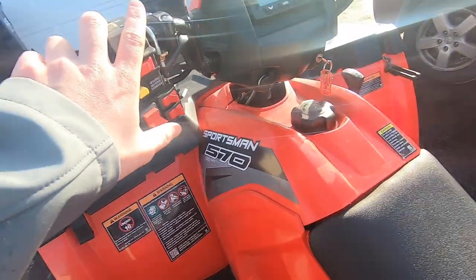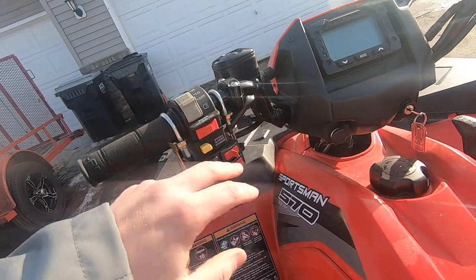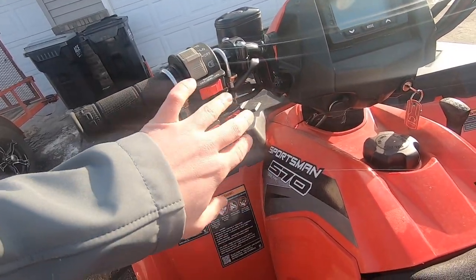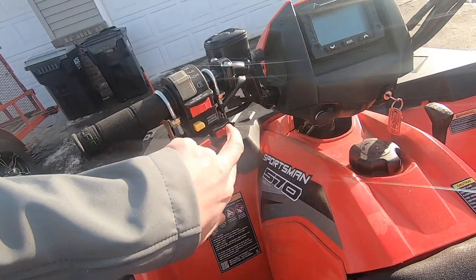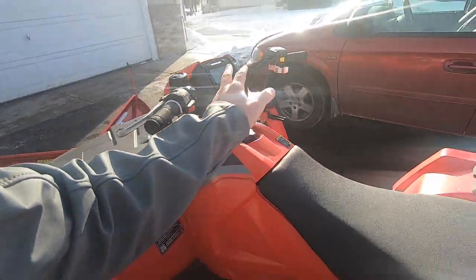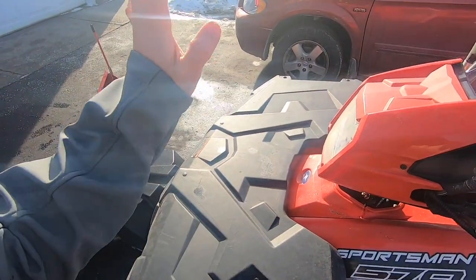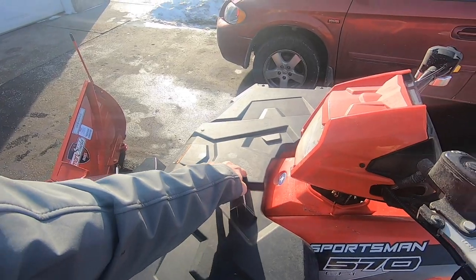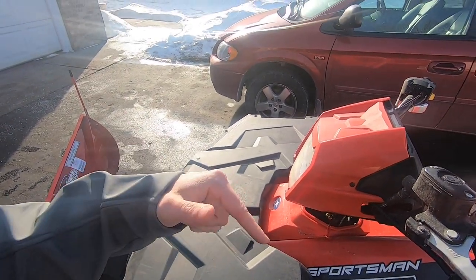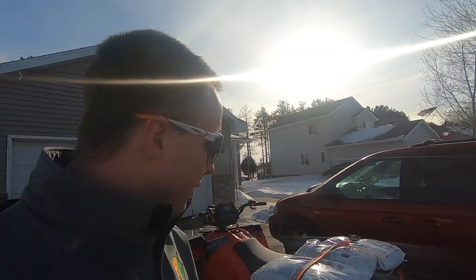Very simple controller here: up, down, push it up, it'll lift it. I ran a video clip of that so you can see how all that stuff works. Your left and your right wing there. And then I forgot to mention that under the hood, just about slipped there and died, there is a wire that needs to piggytail into a tap-a-fuse. You need to go into an accessory panel, 20 amp. Very simple to do, just forgot to mention that.